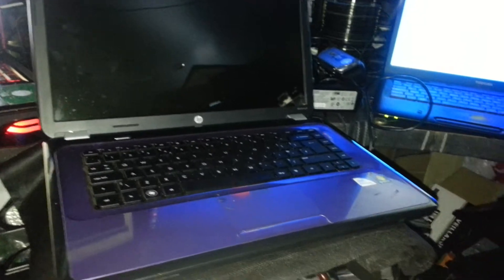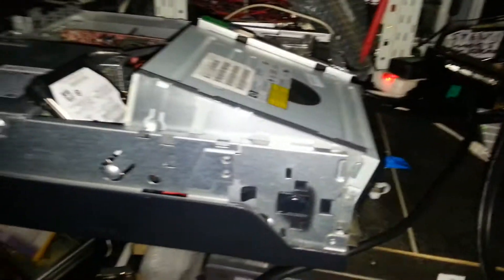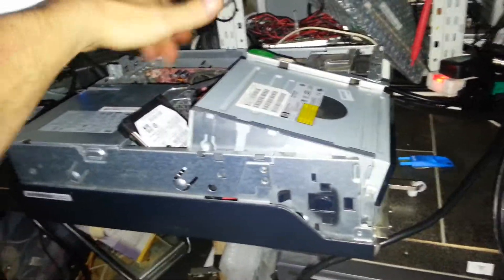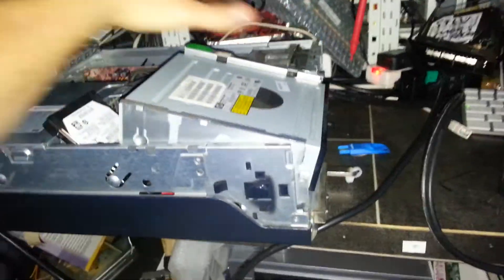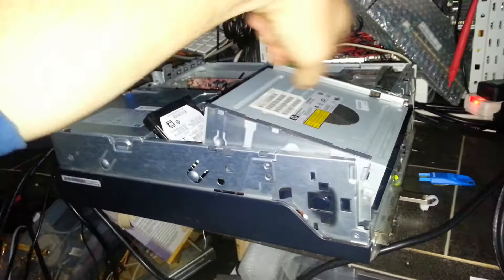Sometimes you can just put the live Linux CD in and it boots up on the machine. I've actually got one running on this now. Basically what I've done is this computer is booting from a live Linux CD — it hasn't even booted from the existing hard drive. As long as the computer is set to boot from this drive in the BIOS, as soon as the machine starts it sees the ISO image on the drive and boots into it.